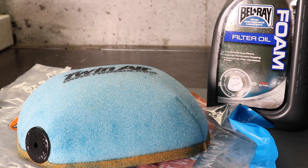The next tip is to have good air filter maintenance. You should check your air filter after every ride. If it's dirty, you definitely want to clean it and re-oil it. Depending on your conditions, you could go one ride or ten rides if you're riding on your own and it's moist with no dust. So there's no particular service interval, but you should definitely check it as a regular maintenance item. It's super important — if you have dirt going into your engine, you will have excessive wear on the piston and cylinder. Air filter maintenance is quick, easy, and very cheap to do.